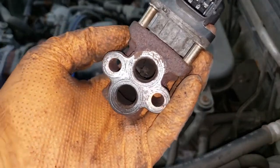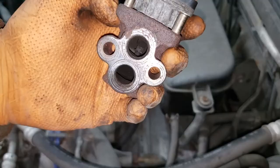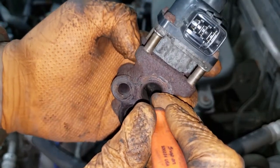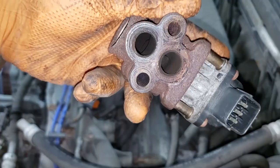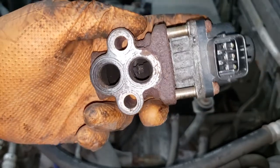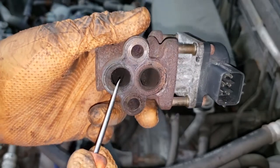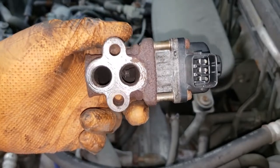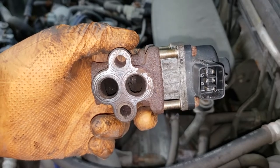The first and most important thing is to inspect the actual valve — look at it to make sure there's not excessive corrosion or carbon buildup, that's a bad sign. The second very important thing is to make sure your valve actually actuates. Take a pocket-sized screwdriver and force the valve down — it should move nice and freely. You can see the valve actually opening as I push down on it, and it closes without me forcing it back shut, which means there's no hindrance stopping the valve from completely closing. If you have an EGR issue at idle with misfiring, you're getting excessive exhaust gases into the combustion chamber because the valve isn't closing — it's usually stuck fully open due to corrosion or carbon buildup. You can take it out and clean it by picking off the carbon with a flat screwdriver and a pick, and usually reuse these things.